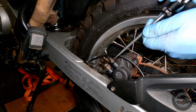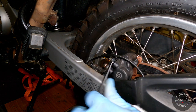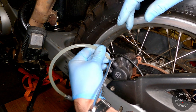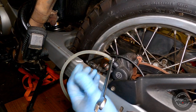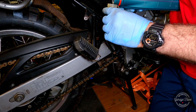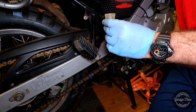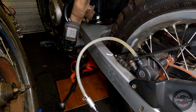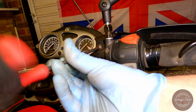I'm pouring some brake fluid in the reservoir here. If I just squeeze the hose, it's going to push out some bubbles and fill the hose and part of the master cylinder with fluid before I start pumping the pedal. And here you can just about hear the fluid dripping out. I'm just trying to get the front master cylinder now, just so I can flush those brakes and make sure it's got fresh fluid as well.